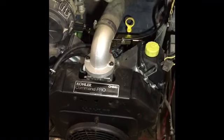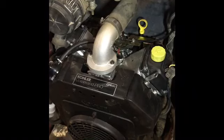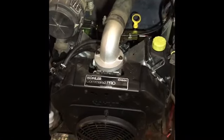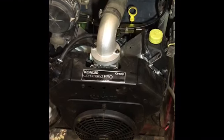You want to change your oil and oil filter on this engine after the first 50 hours for your break-in oil, and after that every 100 hours. Thank you very much. If you need parts, call 703-919-5291. We ship all over the United States. Thank you.